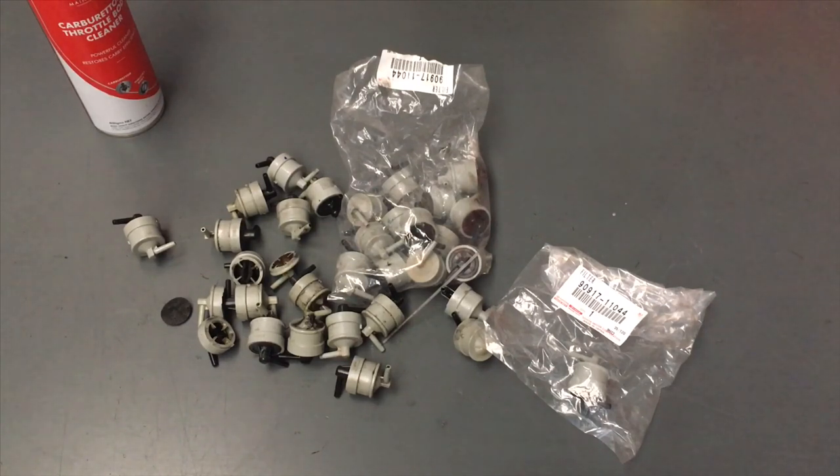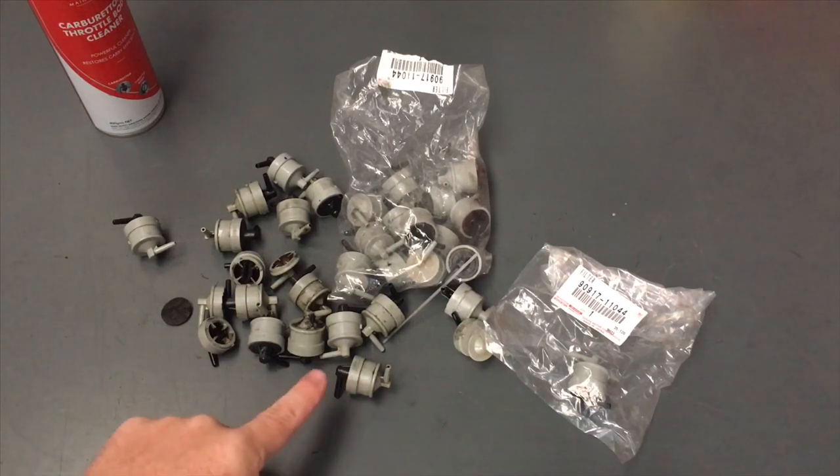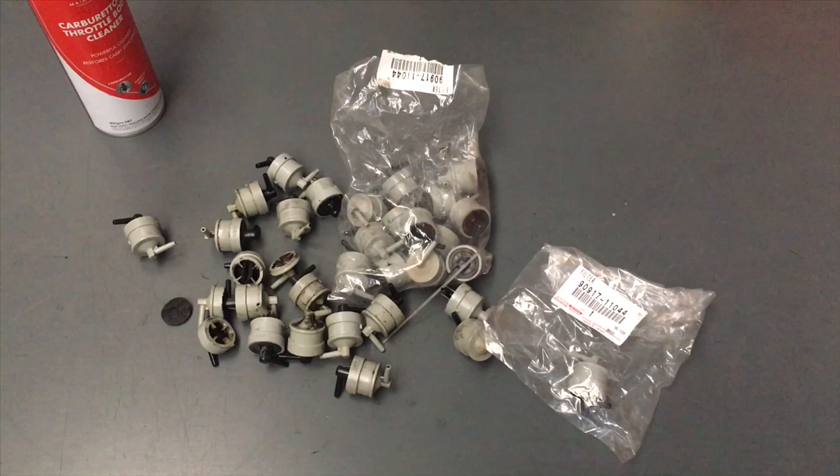Put it in the comments if I missed anything or there's anything else you want to know. I do look at the comments and keep things in mind for the next video. To summarise: replace them if they're cracked, be careful not to push the filter element out of place with compressed air, and be aware that a blocked or damaged filter means wrong readings to the ECU — affecting fuel economy and responsiveness. Alright guys, if you haven't already, subscribe, give us a thumbs up, and check out the other videos on our channel. Thanks for watching.